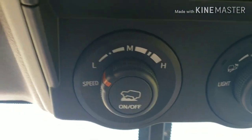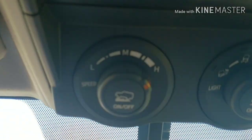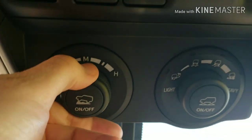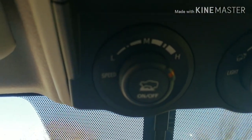The Crawl Control button is right here. First thing you do is just turn it on, and then select your speed. If you're using Crawl Control to help control your speed downhill, you'll want to turn it to the lower speed. If you're using it to climb a very tricky hill, put it on high speed. Another thing about Crawl Control: while you're driving it you're going to hear some clanking, clicks, and bangs. It's going to sound terrible — it's going to sound like you just broke your brand new Toyota — but that's just the traction control and anti-lock brakes coming in and out, doing their thing to give traction to the specific tire that needs it. I'm going to demonstrate that for you on the low speed setting.